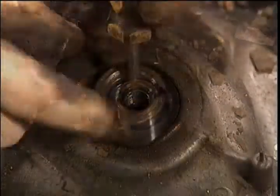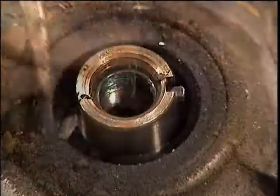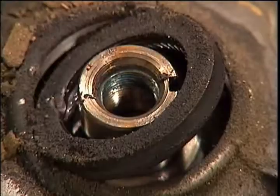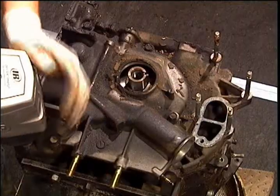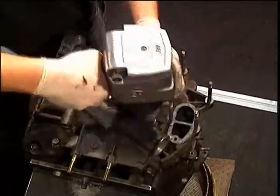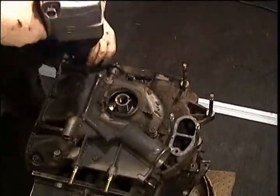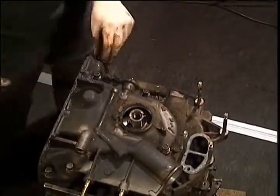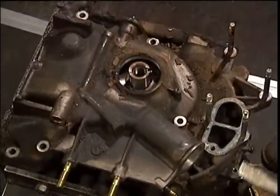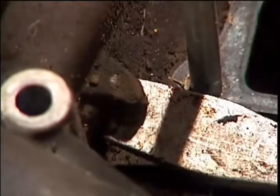Pull the thermal pellet out and its spring. Now it's the easiest time to remove the main seal. Then remove the 12 millimeter front cover bolts. Each of these has one lock washer and one flat washer, and they will be needed when reassembling the engine, so save them. With a screwdriver or pry bar, gently lift the front cover from its gasket.